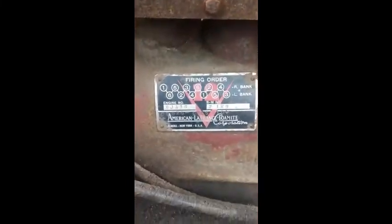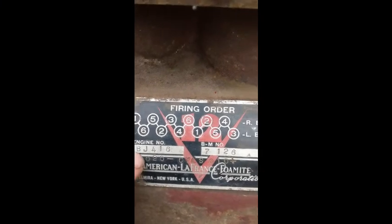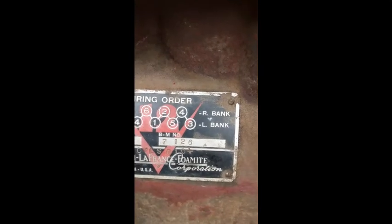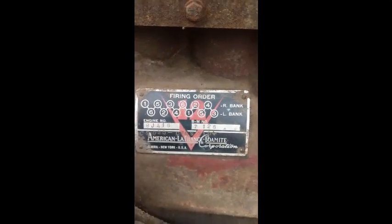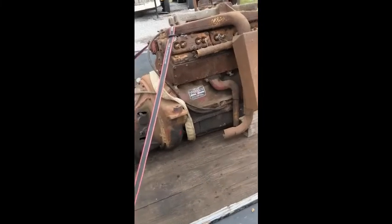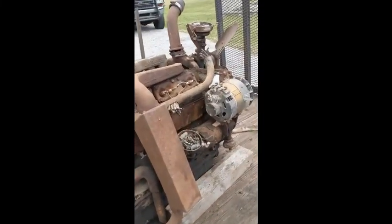This is interesting — on the tag on this thing I've never seen before. If you look closely: CS 020, so that means the crankshaft has been turned 20 and the cylinders 010 plus. I've never seen one that has been modified or rebuilt at the factory.